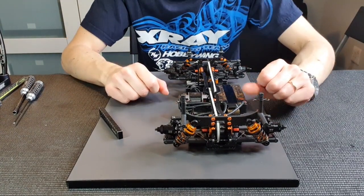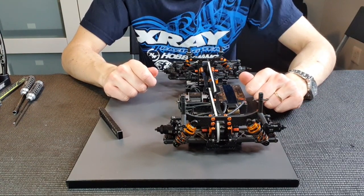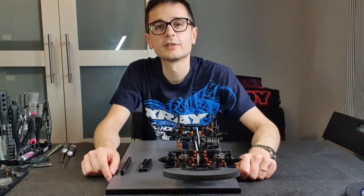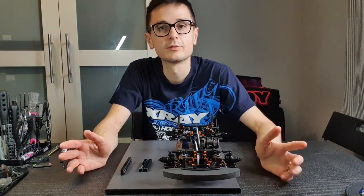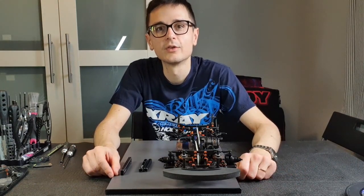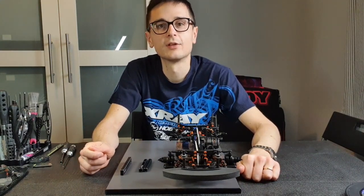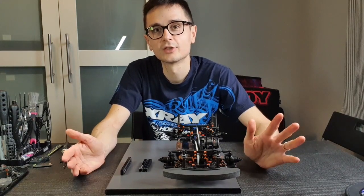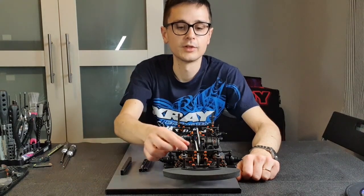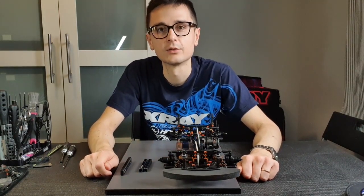On my car here we had a value of 5.6 in the front and 4.6 in the rear. However, our basic setting for asphalt is 5.2 in the front and 4.2 in the rear. Why do we use a lower number on asphalt? This is to generate more chassis roll, which is mainly important for tracks with lower grip or surfaces that are not perfectly flat. Those less forgiving tracks require more downstop to compensate and to generate more grip.